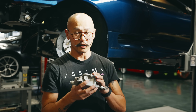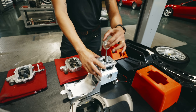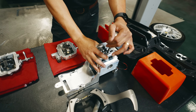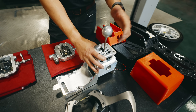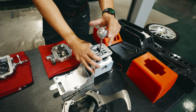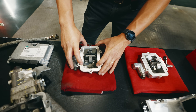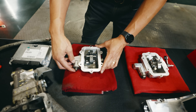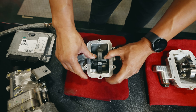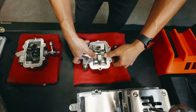One of the concerns this client had was the way the car shifts once we were able to convert the car to manual transmission. The first concern was the return to center. So you can see here the shifter likes to rest between 3rd and 4th. The shifter turret mechanism itself, or shift tower, shifts perfectly fine between 3rd and 4th. But once everything was installed in the car, the issue was that the car would either rest between 1st and 2nd, or 5th and 6th. What we found was on a factory unit, it likes to spring back between 3rd and 4th. This is set up with a check ball, a spring, and a detent on the rod itself — it makes it just want to rest in that position.